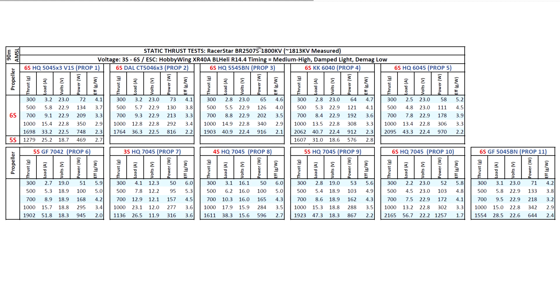So that's the thrust test for the BR2507S 1800 kV, a budget motor from Racer Star costing around $12. As the teardown showed, it's not too badly built. A couple of people have mentioned bearing issues, but at this price you could just order five motors instead of four in case one isn't good. The bearings are standard 4x9x4, so it's worth also ordering some good NMB bearings and replacing them as needed. Overall, a decent motor from Racer Star and a solid option for a budget build. Thanks for watching and until the next one.